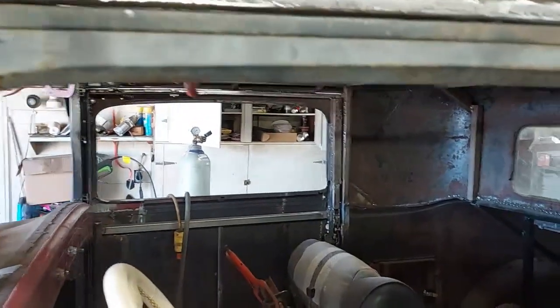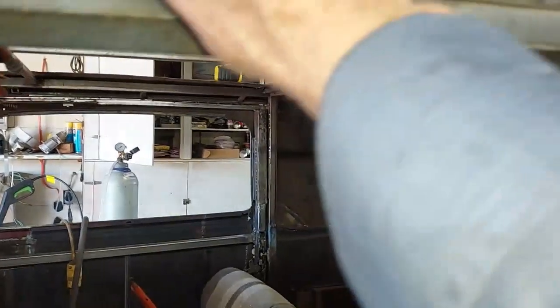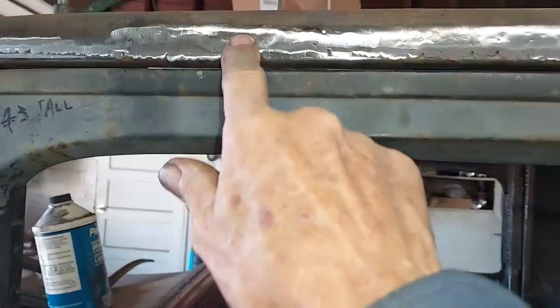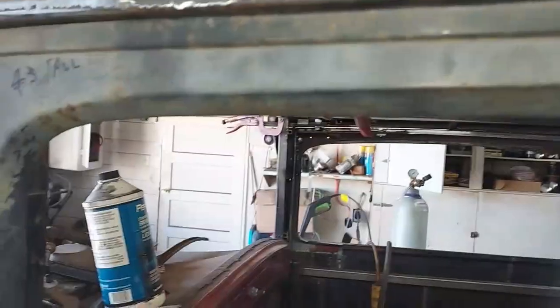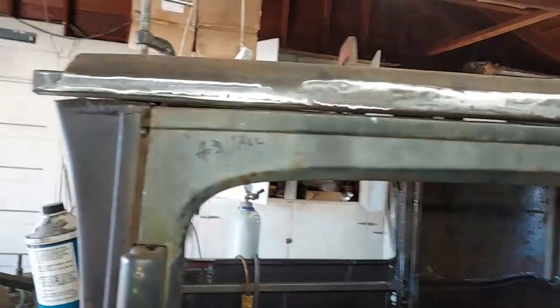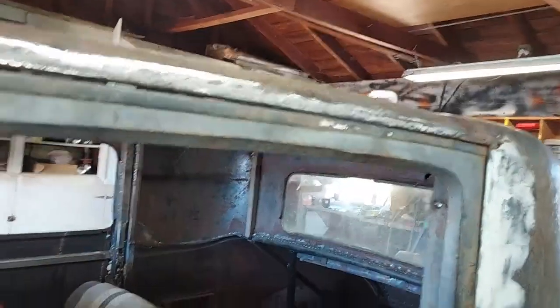When I get done here, I'll just put a smooth coat of bondo on it. Looks like I can still grind quite a bit of my weld off of the bottom. But I got a dent here where it caved in. That's probably where it just had a weak spot and I clamped it and crushed it. Anyway, bondo will fix that, make it look good.